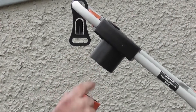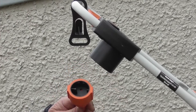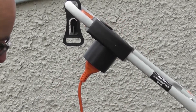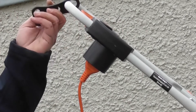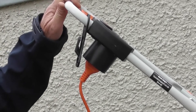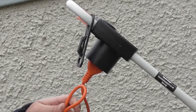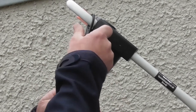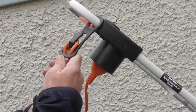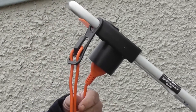The power cable fits into the socket on the back of the lawnmower. You'll see it has two rectangular sides and the rest is circular, so it will only go on in one orientation — simply plug it in. This is where the cable tidy comes into play as a strain relief. If you tripped over the wire or someone pulled on the cord, it could pull the power socket out, so take a loop of cable a couple of inches long, pass it through the lower slot, and pull it down over the little tab. That's the cable fixed on the strain reliever.